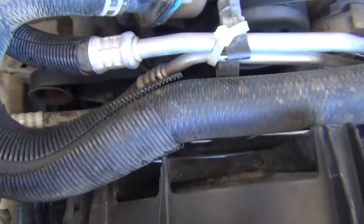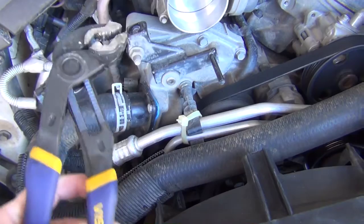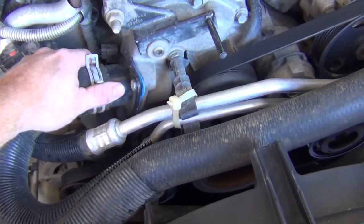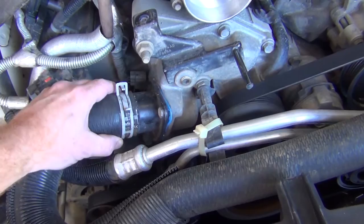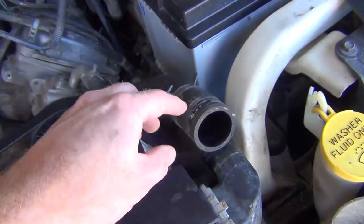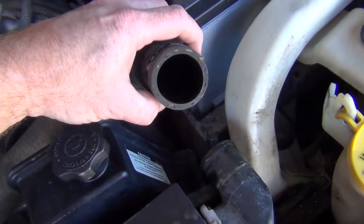I'm making sure as much fluid is out as possible before undoing the upper hose so it doesn't drip too much on the floor. I'm using a vice grip clamp tool — I may need to open it a little because the clamp on this one is wide. Since these clamps have probably never been undone since day one, you'll want to work it back and forth to break it free from the hose. This one was easy — I slid it and pulled it right off the radiator.